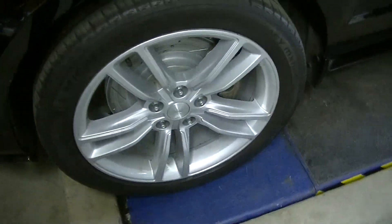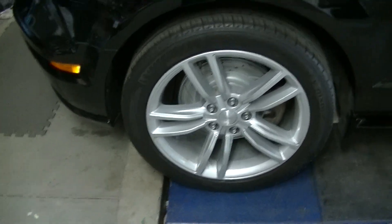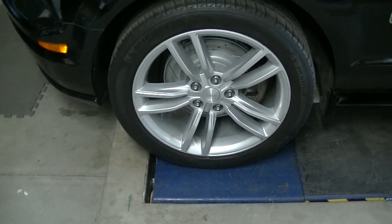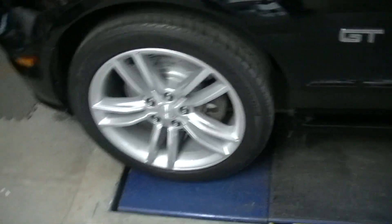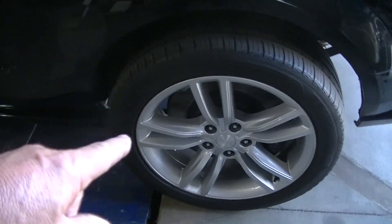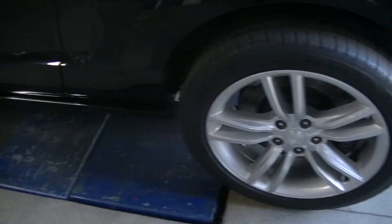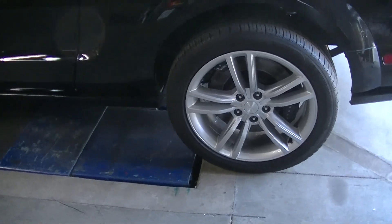The wheels are going to be changed — I'm going to Corvette wheels, which actually look really nice. I'll do a video later on the Corvette wheels. Right now I just have Tesla wheels on it because I needed something to roll it. New wheels will be 18s in front and 19s in back, staggered — 19 by 10 wheels, so I'll put like a 285/35 on the back. I might lower it more because it's sitting pretty high.